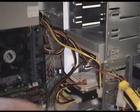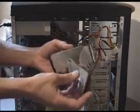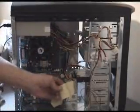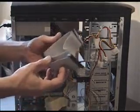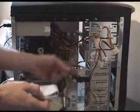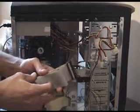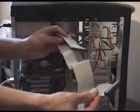Okay, lastly, well not lastly actually, CD-ROM. Take it out of the bag, the other cable. Okay, this is the cable we're going to use to connect the CD-ROM. Now most of these board packages that you get from the manufacturers, they include one of these 80 strand ATA faster cables, the newer ones, for the hard drive. But they always usually chuck in one of these older 40 strand cables. Now they'd mostly, as I said, expect people to put the hard drive and the CD-ROM on the same bus as master and slave, but what we're going to do for the purpose of this PC is have the hard drive on its own IDE bus all by itself, and the CD-ROM on its own IDE bus all by itself, so they're on completely separate IDE buses. Okay, so we take the 40 strand cable. Again, it has a longer bit with the two connectors at the other end.